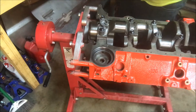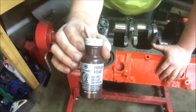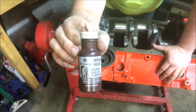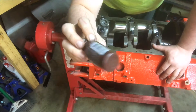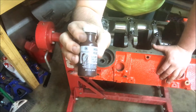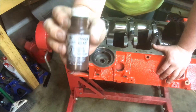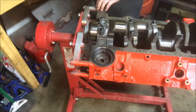The next thing you're going to need — and there's a lot of suggestions out here, I'm just telling you what I use from personal experience — is Indian Head by Permatex. This stuff works really good for a lot of stuff. I think this has a heat point to like 350 degrees, if I'm not mistaken. But this is water safe, it doesn't break down with water or steam, so it'll handle heat and stuff.